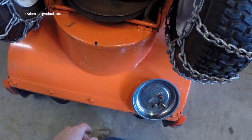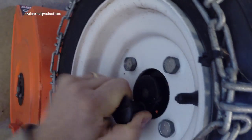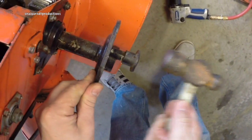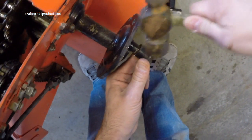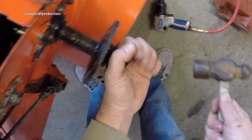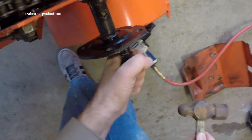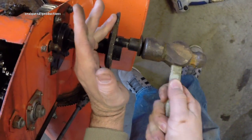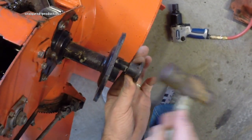The other thing I want to do — I'll take these wheels off and look further at this differential because it is locked up and frozen, so we want to figure this out. It's moving — that's a good sign. We'll keep tapping. I've got rust coming out so that's my problem.